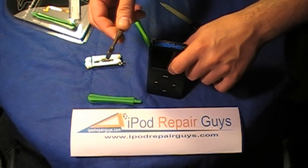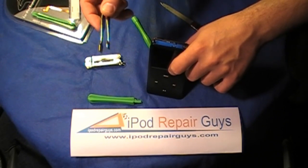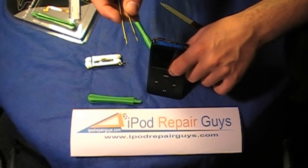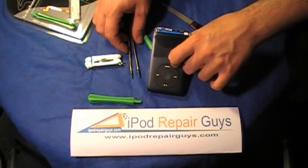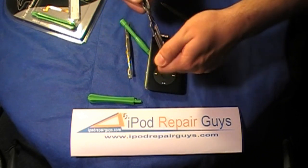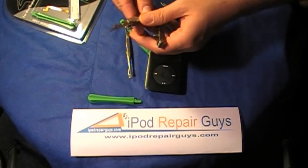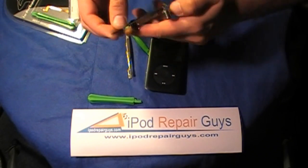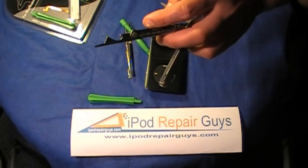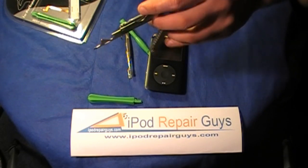I did have a pair of round edge tweezers — not sharp or pointy. They are very thin and cause little damage as long as you are working delicately with them. There is also a handy multi-tool here with a few attachments. This piece I found very helpful just because of the thin, slightly angled tip of the tool. It was a good tool to actually start to disassemble the two halves of the iPod.